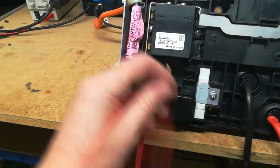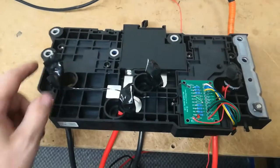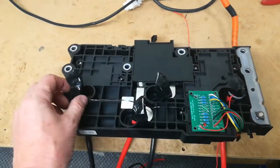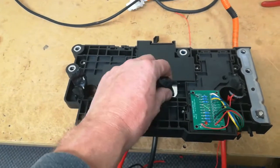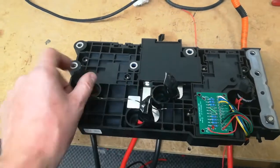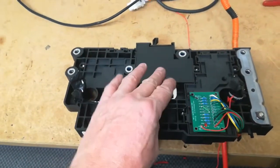We've got a double wire here — two red wires, I'll explain those in a minute — and then we've got the voltage tap wires coming out here. On the other side, we've got the four connections insulated and tie-wrapped to the little support posts, with self-locking nuts and bolts to keep these connections really tight, because they're potentially passing quite a lot of current.